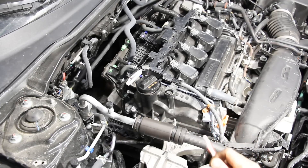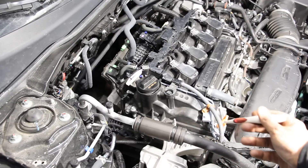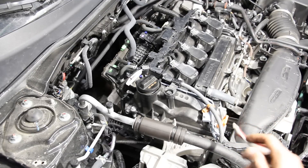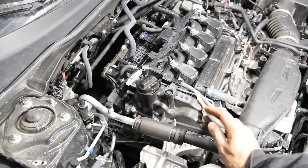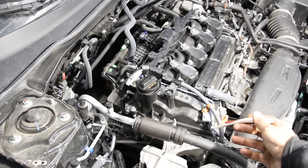Taking a look at the front of the engine on the passenger side, down underneath the engine mount is the timing cover, and underneath that is a timing chain — meaning this engine does not need periodic timing belt service. Over here we have the exhaust camshaft, and on this side the intake camshaft. Both camshafts have variable valve timing through a VTC system for cam phasing.